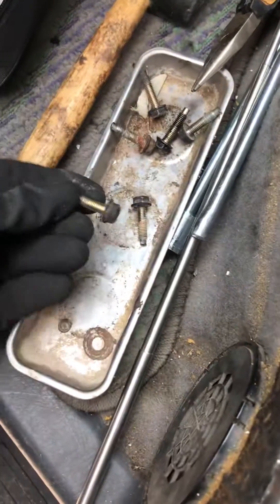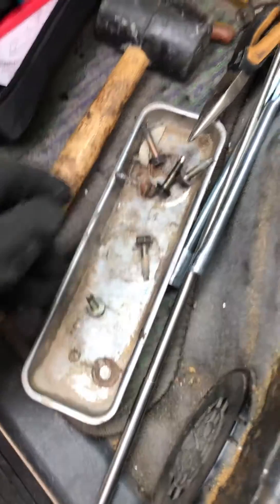To get this off, these are the bolts — one, two, three, four, five, six. There's supposed to be an order of taking them off and putting them back on again. You do these two central ones, then top and bottom, then top and bottom.